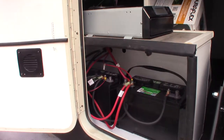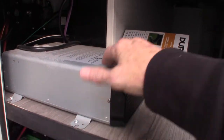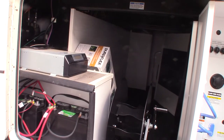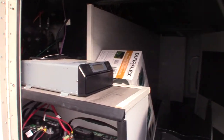When you're towing down the road, your tow vehicle is charging your batteries, and then the power is converted and goes to your refrigerator. Now this also converts power, which is the opposite — converting goes from AC to DC, while inverting goes from DC to AC. I'll talk more about that when we get inside.